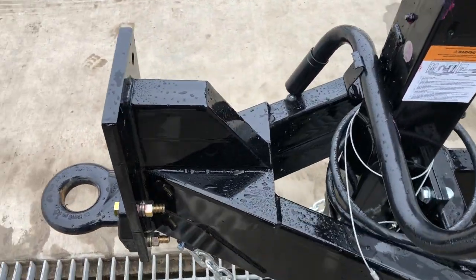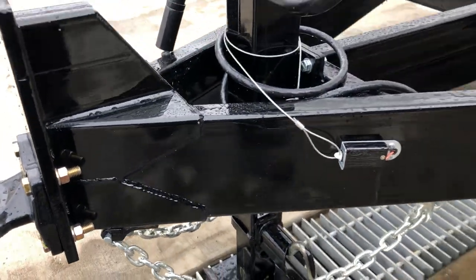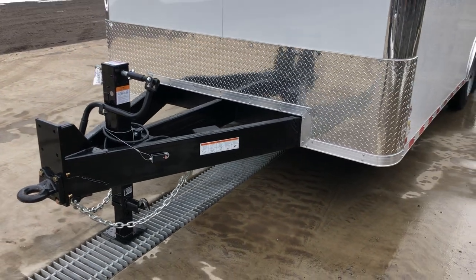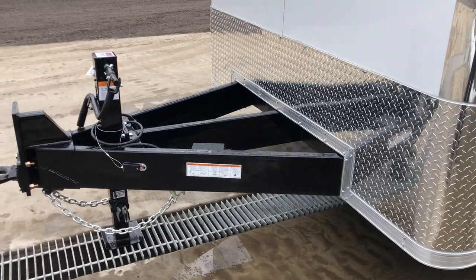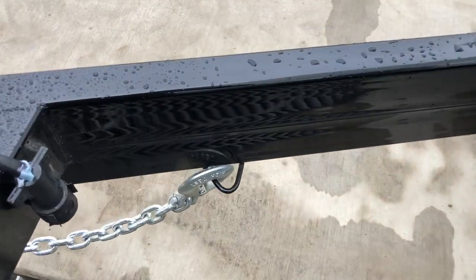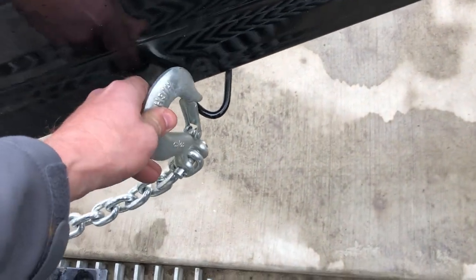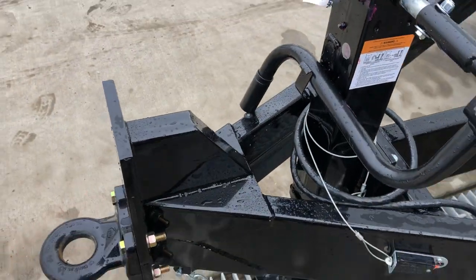Also on the coupler, you'll notice it's heavy-duty reinforced with gusset plates going back. On the 8K axles, ShoreTrak upgrades to an 8-inch frame and a heavy wall, so a good bit more substantial tongue area. It also has a triple tube tongue instead of a traditional A-frame. It has heavy-duty safety chains instead of the lighter-duty ones you'd normally get, and also an integrated chain holder.